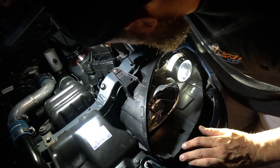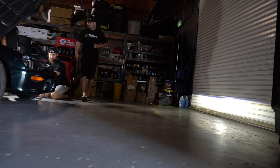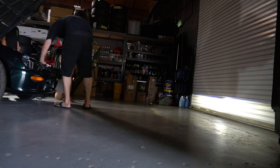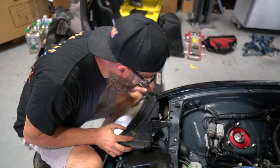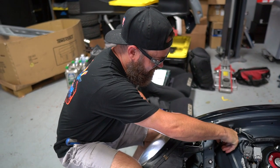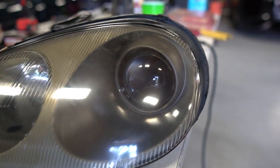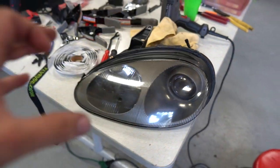You're already pretty adjusted if you look at how much thread is through that — no, it's definitely hitting on the bottom of the housing. What we might need to do is actually mount it on the front of the bracket. What do you think about retrofitting to the extent that something has to be redone once you've completed damn near everything else? Yeah, that sucks — if you don't take your time and do it right the first time, you've got to do it again. As an installer, that costs a lot of money because time is money. This is the bi-LED projector in there — it was crazy, we had to take it apart a lot of different times and do a lot of different trimming. Lots of modification to that factory bracket. It looks really cool.